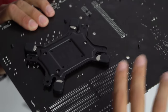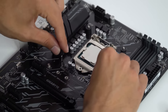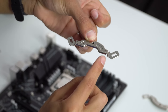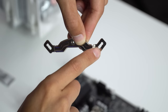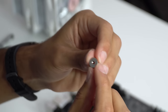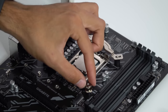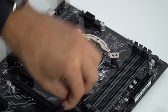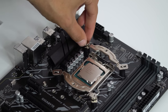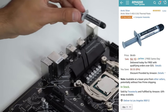Line the bracket up with the four mounting holes on our motherboard and let it fall into place. Turn the motherboard around, then place the spacers on all four screws — they should slide right in. Next, make sure the mounting arms are facing the correct direction — the post needs to be sticking up. Line up the middle hole with the screw on both sides. This heat sink comes with included thermal paste, but I'm going to be using Arctic Silver 5 instead.